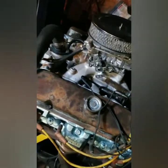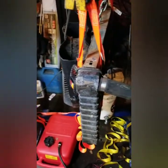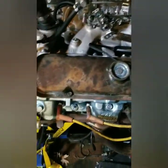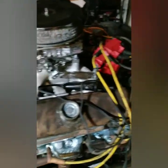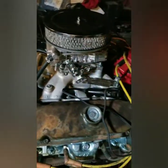She'll be ready to go. I'll get that transmission in here, get the new seals and kit in it and all that stuff, and hopefully by then my new valve covers will be in and my new carburetor for this motor. This is too small — this is a 600. This thing should have at least a 700 or above.